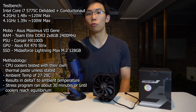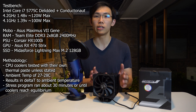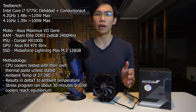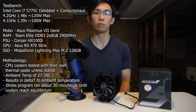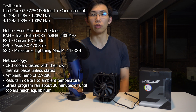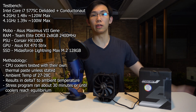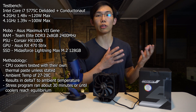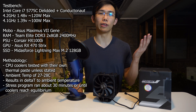On the test bench, it's going to be a Core i7-5775C, which is a Broadwell desktop CPU — a 14nm CPU that I delidded for maximum heat transfer to the heatsink, so you can really see the differences in performance between cooler designs. It consumes around 120 watts or more at full load at a maximum overclock of 4.2 GHz. I'll also be doing a 4.1 GHz overclock for testing lower power outputs for weaker coolers. I'll be recording both max and average temperatures over a 30-minute span, with the room at around 27-28°C, using delta temperature to ambient for accurate comparisons.